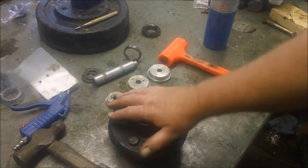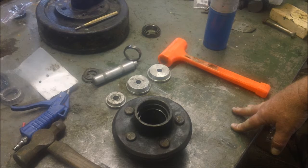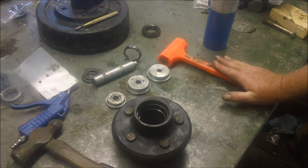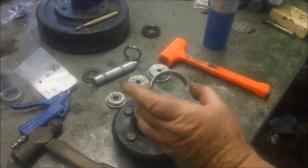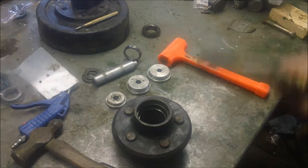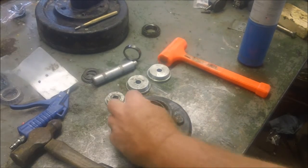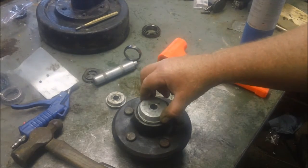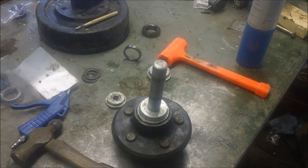So anyway, pretty much, you know, mechanics is mechanics. What works on the motorcycle and the chainsaw cases, putting in bearings, works with this. You have the ability to warm this up and expand it and chill down the races, and they'll go in a lot easier. So right now I have one of these sitting in the refrigerator, and I've got this out here, and I'll warm it up with this propane torch. Doesn't have to be too much, and then I'll hope I can just set that in there without burning my fingers, and then take this tool right here to drive it home.